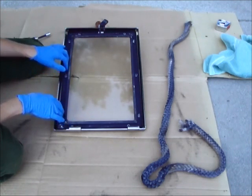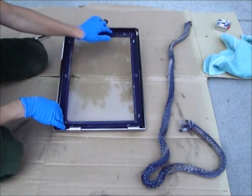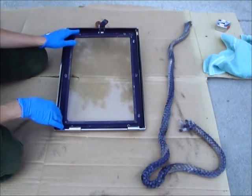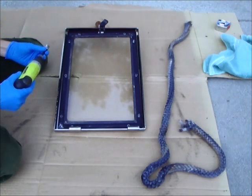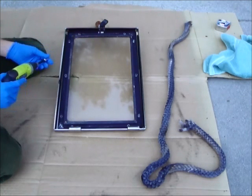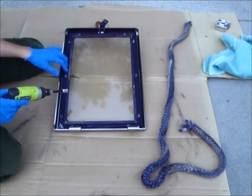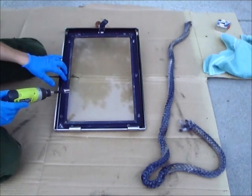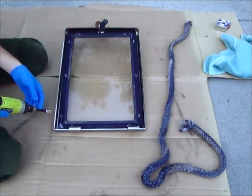As you can see, we've already removed the door from the stove and taken out all of the stove's old door gasket. Now what we're going to do is remove all of the nuts or screws — I have nuts on this one. Some doors have screws holding down the glass brackets. Sometimes the screws or nuts won't want to come out and you'll need to use a lubricant such as WD-40.